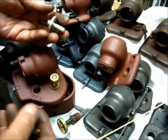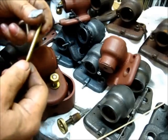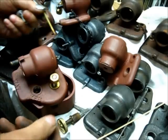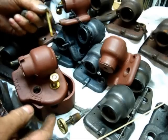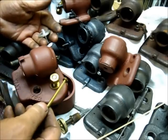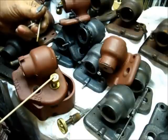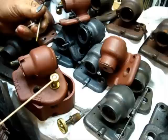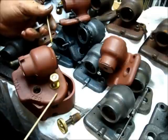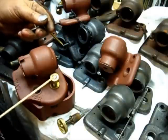I have spent a little time building these compensating valves, also the compensating valve slide pin. A good rule of advice is to build the parts out of the same material that they were built from in the factory. As you note, these stainless steel stud bolts and the brass washer and nut — that is a very, very bad idea. Just do not do that. There is a reason that I make that statement.